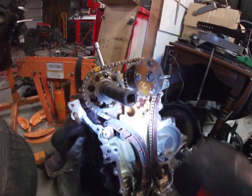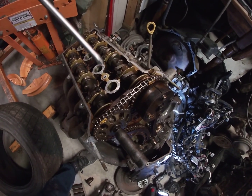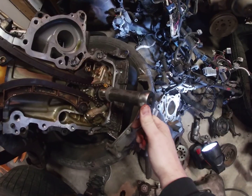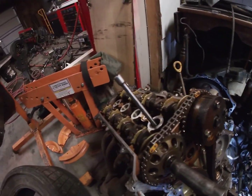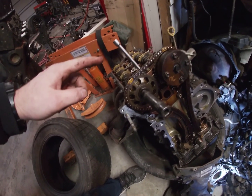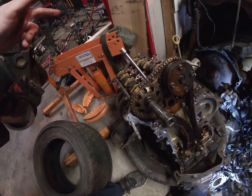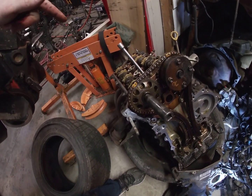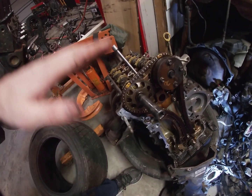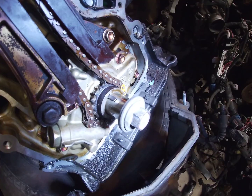To get these on time, the first thing you're going to want to do is make sure it's at the top dead center of the number one cylinder. What I do is take the spark plug out of the number one cylinder, and I've got a long three-eighths extension — I just set that down in there, then turn the crank one way or another until you get to the top where that stops moving. If you have the other spark plugs in when you get to top dead center, because there's two pistons that get to the top at the same time, the other one will go from compression to expansion, so you'll feel pressure against it, and then all of a sudden you'll feel it relieved — then you know you're at top dead center on number one.